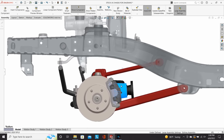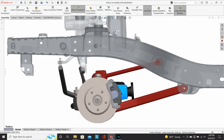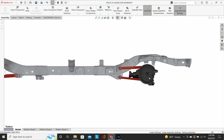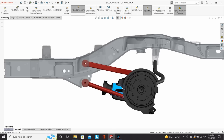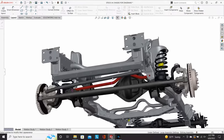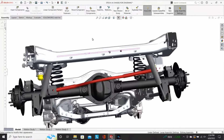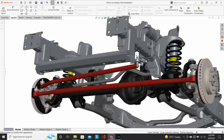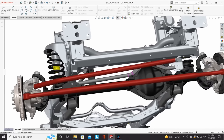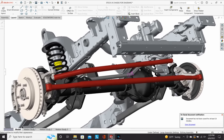Control arms are going to limit your axle's relative motion to the chassis fore and aft. If you hit a bump coming forwards the control arms are going to keep your axle from coming back towards the chassis. Track bars are going to limit your axle's movement side to side as you're cornering. Your drag link and tie rod are going to be your steering links, which also have to cycle with the suspension and allow you to steer.